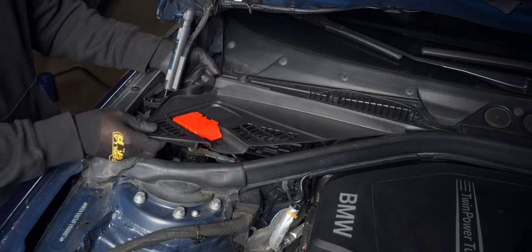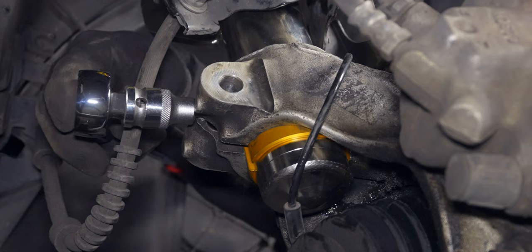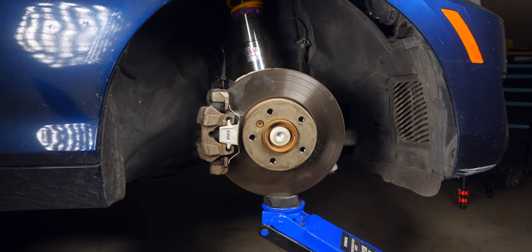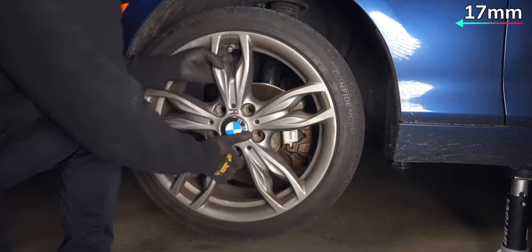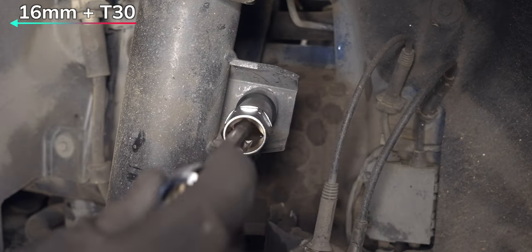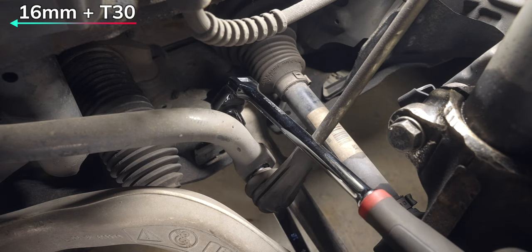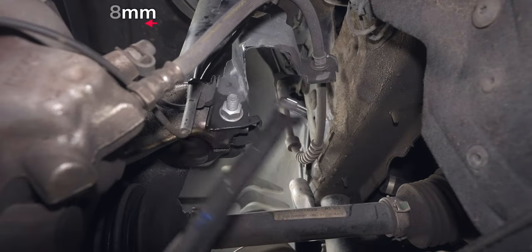Then place back on your weatherstripping and cowl. Heading back down, keep the assembly jacked up as you remove the spindle spreader and place back in the wire harness, then torque the pinch bolt to 44 Nm. Then we can lower it down without the risk of the strut body coming out — don't place on your wheels yet. In order to properly install the end links, we need both front coilovers installed. Since the OEM sway bar uses rubber bushings, this has to be done at ride height, with both end links in their respective positions. Unless you have aftermarket sway bars with polyurethane bushings, then you can set it to whatever you want at full droop. Just make sure you have clearance with your control arms at ride height.